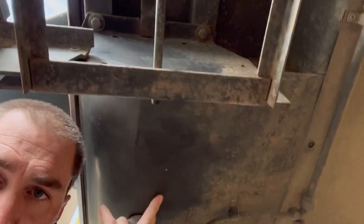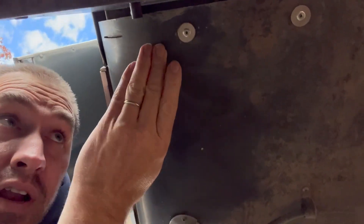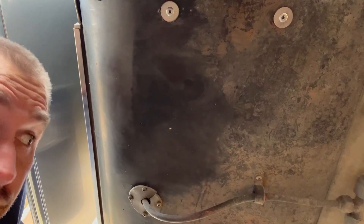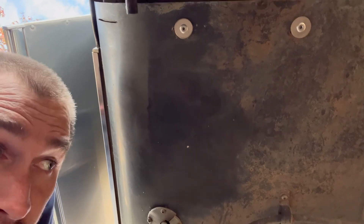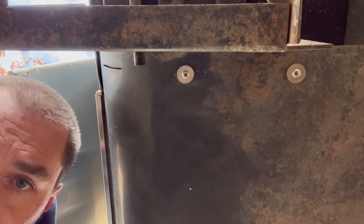Next to the step here I've got an issue where the rivets are pulling through, and I've tightened that up pretty well in several places all around the body. I just don't like the idea of there being half an inch of play in the belly skin everywhere underneath the trailer. I've got a few more of these rivets to do like this, but I did a bunch of them and it's a lot better.